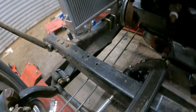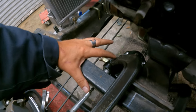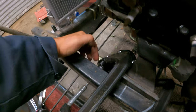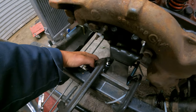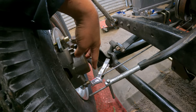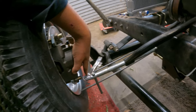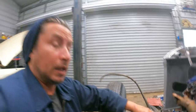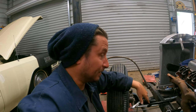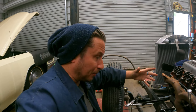The steering box seems like it's in the right place. So now that this is here, we're gonna need to figure out what kind of custom brackets we need to hold it on. And then we're gonna need to figure out how to modify our steering arms, whether we wanna go with our steering set above the wishbones or below. I think both will work. Just, you know, there's a couple ways to skin that cat. And we've got to figure out an order of operations.